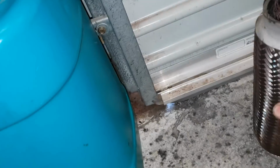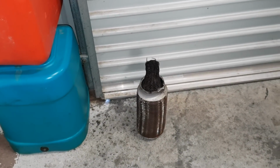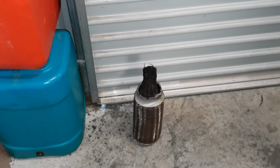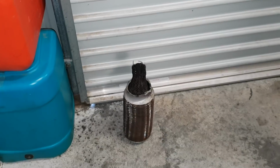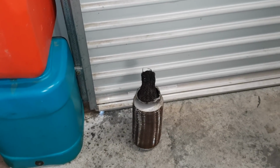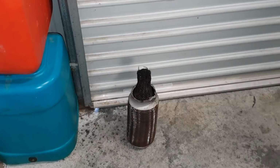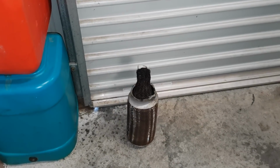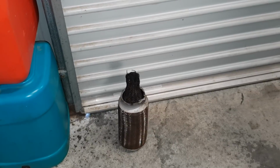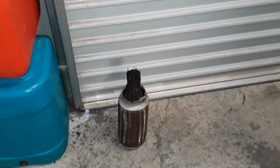Yeah, and I tell you what, I'm starting to think that wouldn't have helped, especially when I went up in boost around the 15 pound mark. I've got a funny feeling that would have been a little bit of the cause to giving incredible cylinder pressures, because you can't get rid of the gas quick enough. You would have had an incredible pressure on the hot side. If you can't get rid of it all out of the exhaust, you're still going to get some stay in there and obviously swallow for the next fire stroke. And you've got contamination, and I reckon that's what was happening. And then we would have had incredible cylinder pressures, and it would have got so hot and almost an uncontrolled burn, all because of restrictions. So won't be running them again, guys.